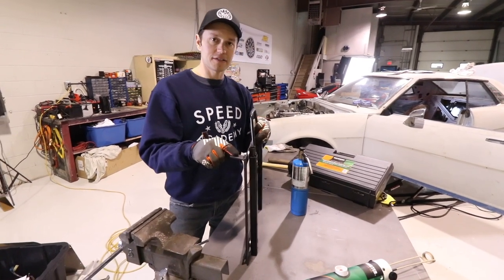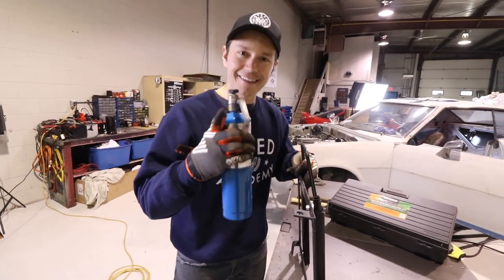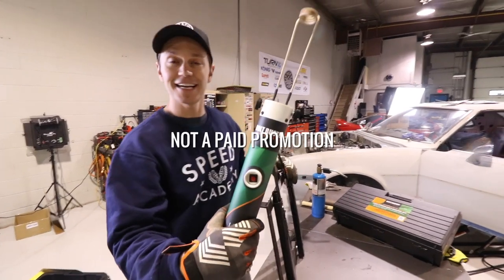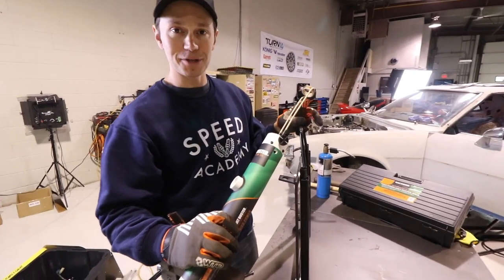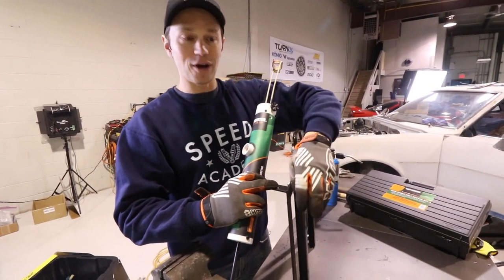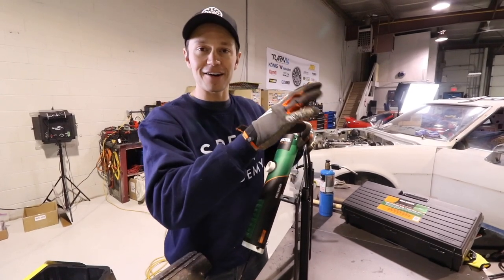This is pretty thick steel, and in order to bend this, you probably want to put some heat into it. I was going to use the old propane torch, but I have a new product that I've been dying to test out, and I'm not going to say this is its intended use. It's called the Bolt Buster, and it is a heat induction tool. It heats these two coils up to a very hot temperature and localizes the hot spot, versus a propane torch where you're heating the whole area up. And if there's grease like there is in a slider, the flame's going to get in here and may burn that off and wreck stuff.